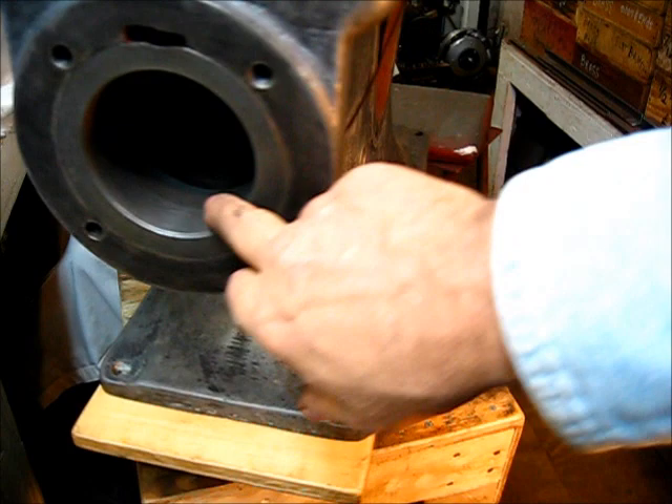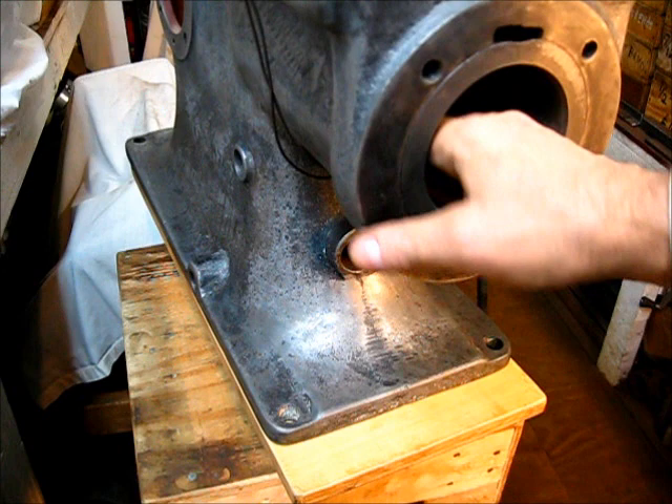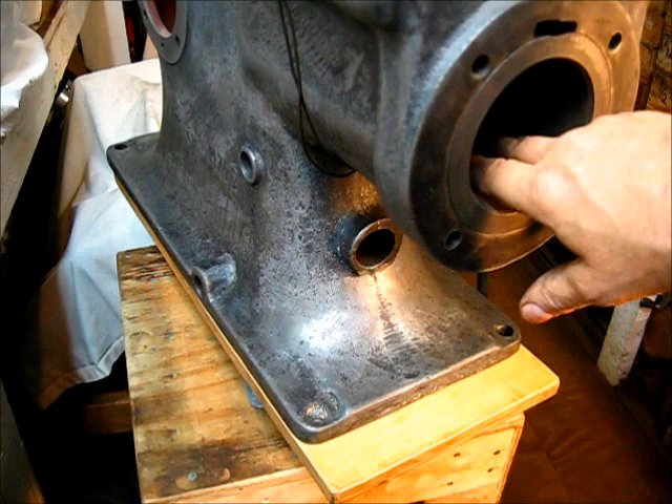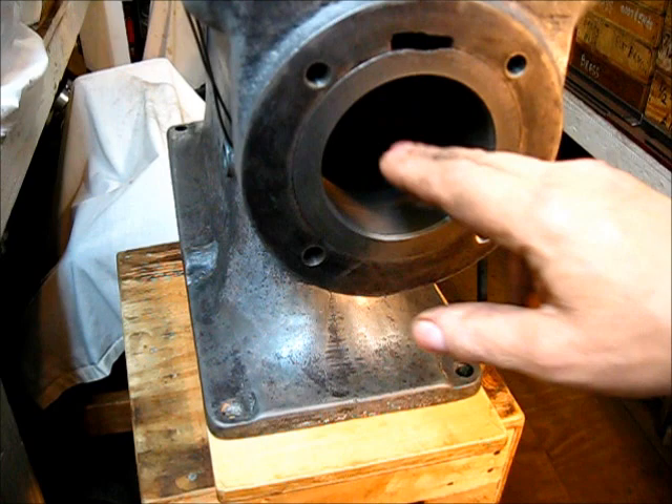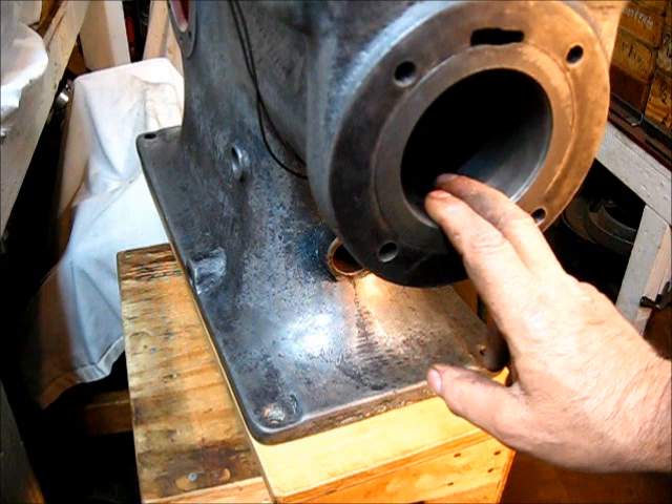Breaking the glaze is the important thing. The cylinder will glaze over, and if you look down in there, there's a discolored area — that's where the piston comes up to. If you feel it with your fingers it's hardly noticeable where that transition is. You can tell it's there but it would be really hard to measure — very, very little. But it is where that piston stops traveling.